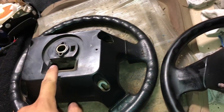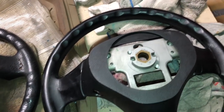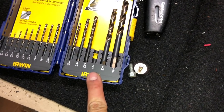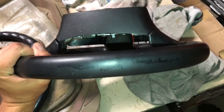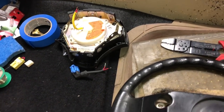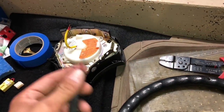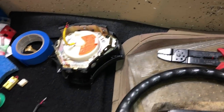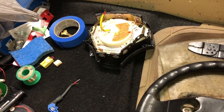You're marking the clock spring location so that when you stick the wheel on there, the paint marks — some people use grease or lipstick — will mark their positions so you can know your distance. Grab a drill bit that fits and drill those holes. Take a chisel and just dimple it there first. As for the cleaning, I scrubbed the whole thing. Regarding polarity: both wires are just solid red on the NA and NB, so it doesn't matter which way you attach it — it simply sends power through and grounds in the ECU.